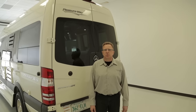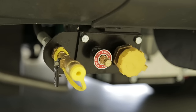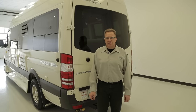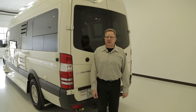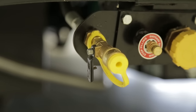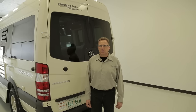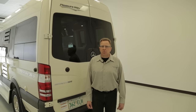Your coach is equipped with a propane fill and bleeder valve. The bleeder valve should be open when filling your tank. Your onboard propane tank is set to fill only to 80% — when you see fluid coming out of the vent line that indicates 80%. However, the gauge inside the coach will indicate 100%. Vehicles are also equipped with a quick-connect regulated barbecue tee off the propane tank. This is a regulated tee, so if your appliance has an additional regulator it may not operate.